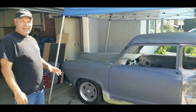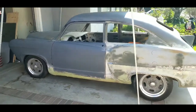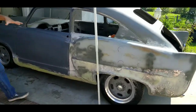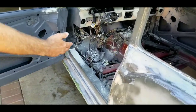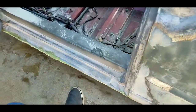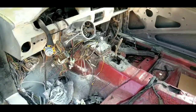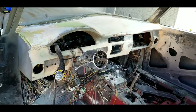So we got the Henry J Sears Allstate, and I gutted it, and then I skinned a 95 Mustang GT and set it right on top of it. And then I had to blend the rockers here — the Mustang to the Henry J — which is why you see a lot of the Mar Glass or Fiberall. And I put a 58 Ford dash in it, but I'm still trying to get things to line up.